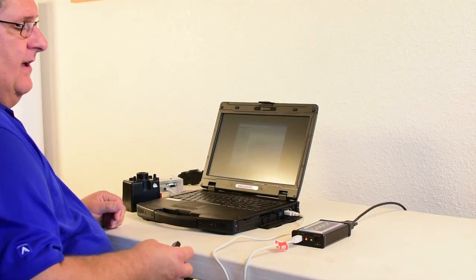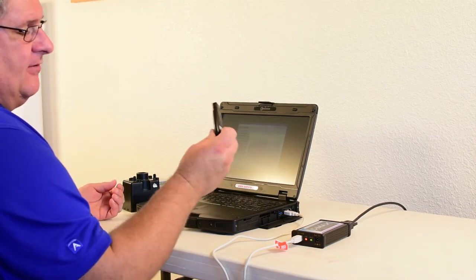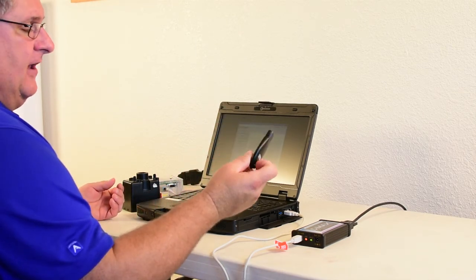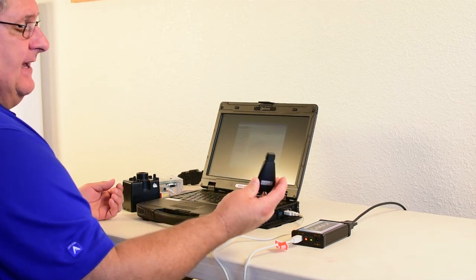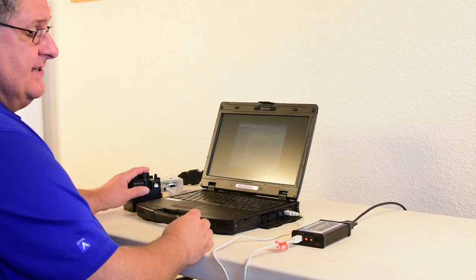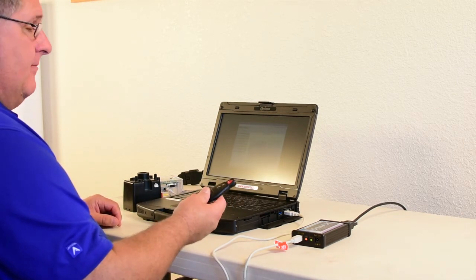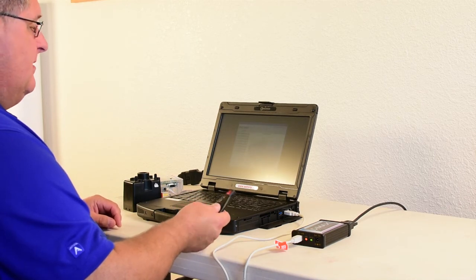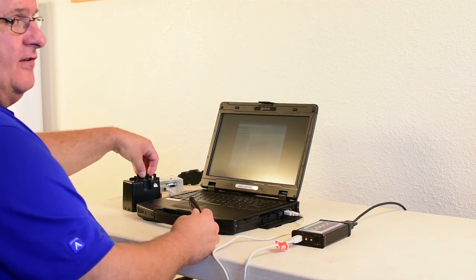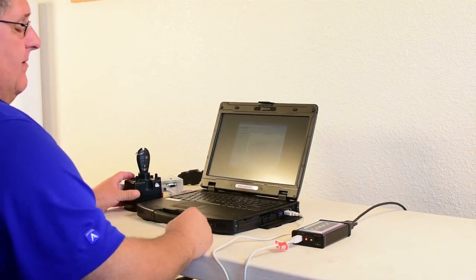If the vehicle is not starting in proximity mode, make sure you have the correct key type from your key vendor. If you're programming a regular prox key into a keyless go system and it doesn't have the proximity antenna, the PEM replace is going to fail and the car is not going to start in prox mode. At that point, you would have to remove the start button, manually insert the key, and start it with the button removed.